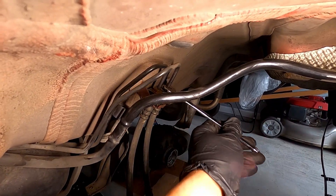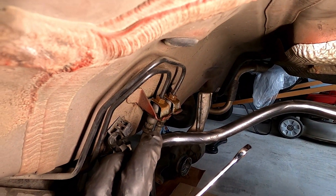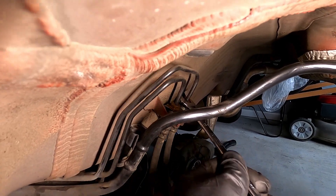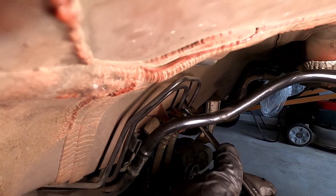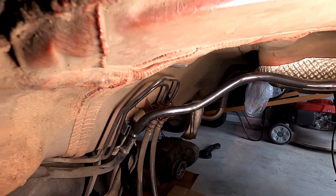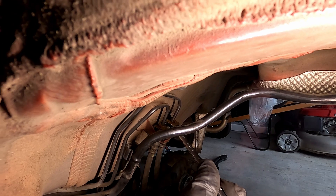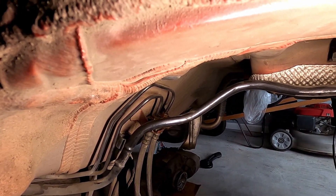This one on the other hand — there is rust and it's already twisting with the tube. I think this tube is done. The brake fluid is clean, it's just pushing all that rust out. I can let it sit, hoping the brake fluid will help with the rust, but I think that fitting is done. Unfortunately, with an older car I had to replace these hoses on, it didn't have that much rust and I could remove those fittings. This one is a pain, so I'll have to figure that out.